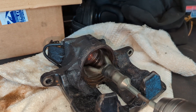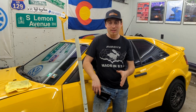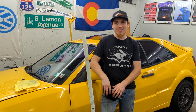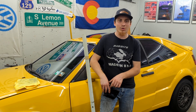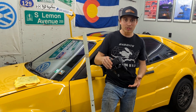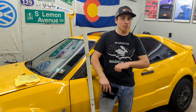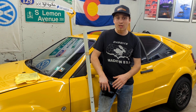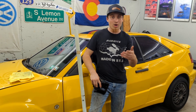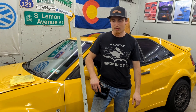The test drive went absolutely great until it didn't. The car felt amazing — for the first time driving it since I've owned it, the front calipers weren't just locking up. The ABS worked perfectly and the car felt like it had way more horsepower because the brakes weren't always on. But then I started smelling brakes again, which has been a really familiar smell with this car. Back to square one — I thought the calipers were bad at the start and now we officially do have a bad brake caliper. I opened up the brake bleeder to let the pressure out and it was still dragging — just enough that they got hot over time. Turns out these brake calipers are extinct. Rock Auto says they have them but when you put it in your car it says they don't — same with AutoZone. Really frustrating.